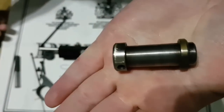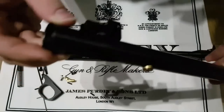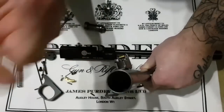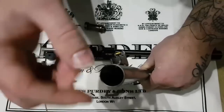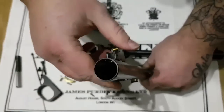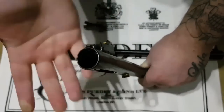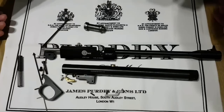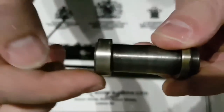The hammer itself just slots out. Now this main tube is full of gunk — I mean full of gunk. One thing I did was just get a bit of rag and a bit of like wooden circular tubing, wrap the rag around it, put it down the tube and twist it a few times to get all the gunk and grease and dirt out of there. Obviously the manufacturer pumps it in just to keep it safe, but there's no need for all that gunk, so you can remove a large large amount of it.